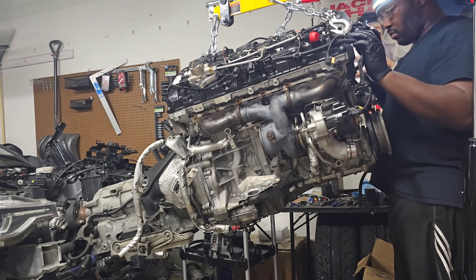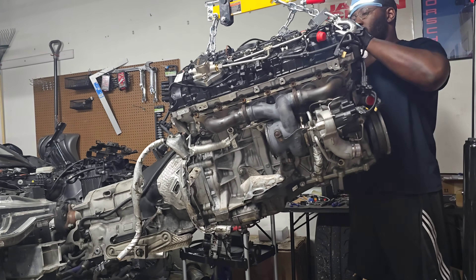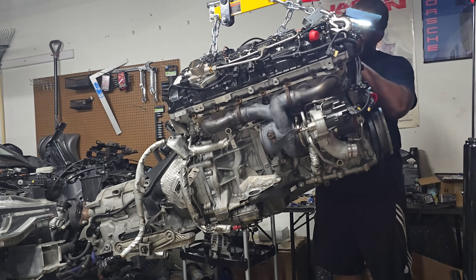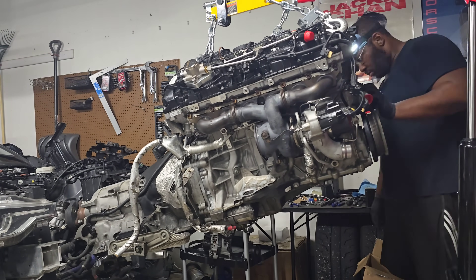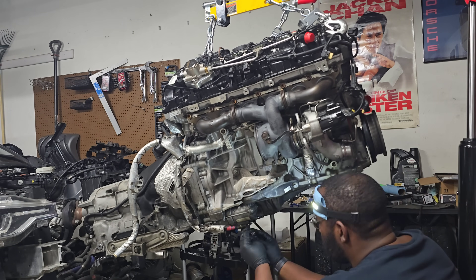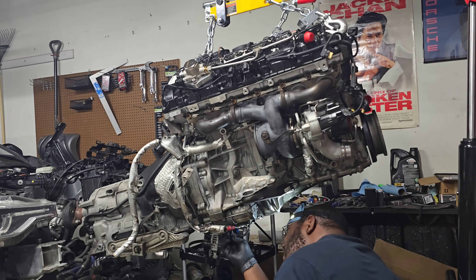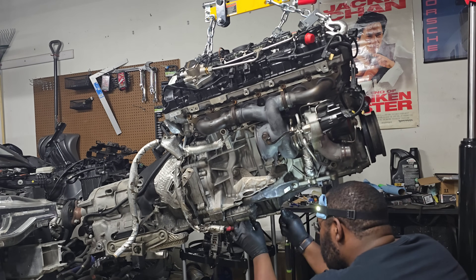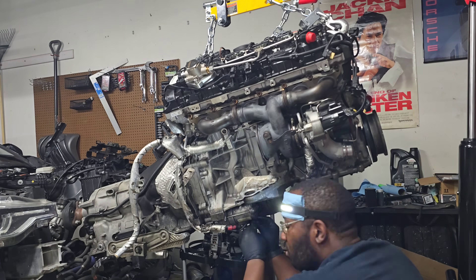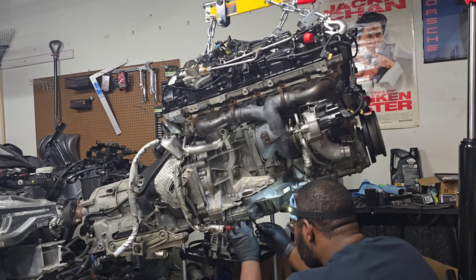This process wouldn't have been as tedious, except I was hell-bent on not pulling anything I didn't have to from the new engine — that included the intake manifold and everything else that was kind of keeping the engine sealed. I wanted to avoid loosening or changing anything that could introduce new points of failure or leaks. I just knew once I got it installed, I would be able to verify the engine was healthy before putting it back to full power. So I spent probably an hour swapping all the harnesses over that go on top and underneath the engine. Just keep that in mind if you have an F-series and buy an engine from a G-series or vice versa — even if it comes with the wiring harnesses, you'll still have to swap all of your stock wiring over.